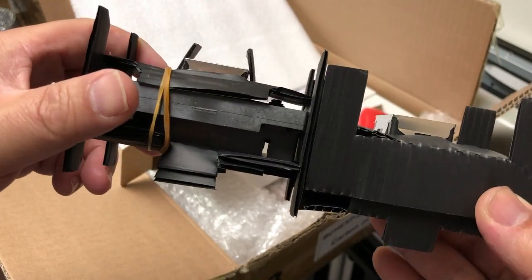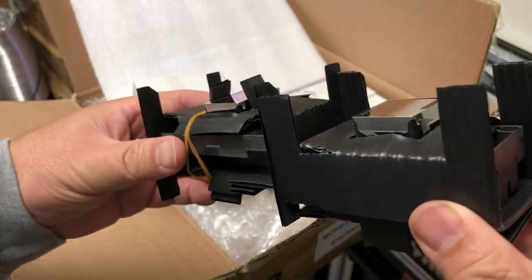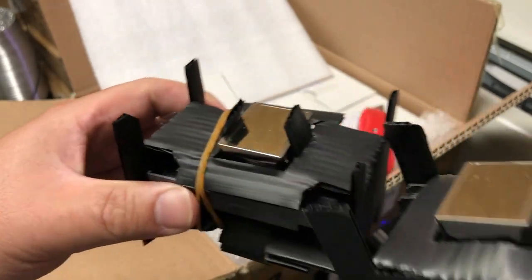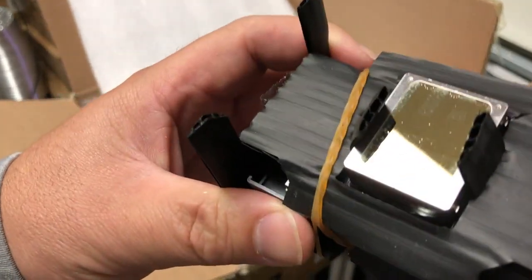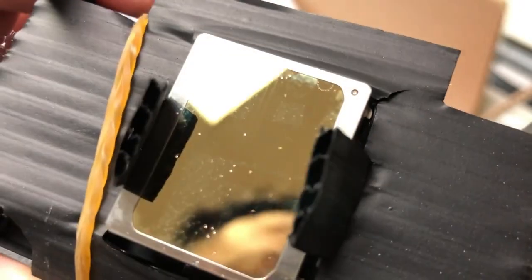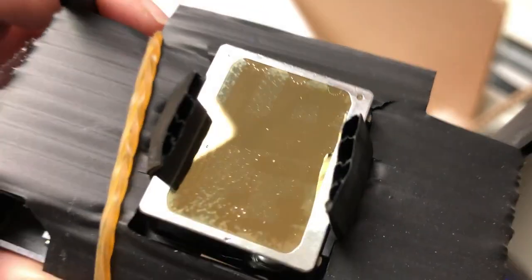The genuine one - I can see the printhead from the side, but the refurbished one is just one bigger chunk. And the new ones will not have lots of horizontal scratches. Although it may look dirty, you can see there are no horizontal scratches.